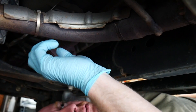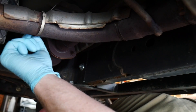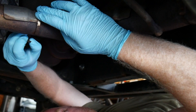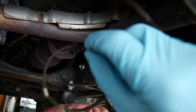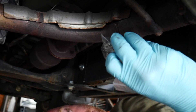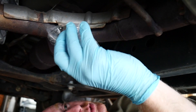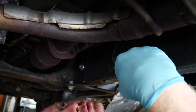So we're under the truck here, and this is the little clamp. As you can hear, it gets pretty crazy and loud. As you can see here, this one's broken. So what we're going to do is slide this one off, look at the diameter, take our new one, mark on the circle with a Sharpie pen as tight as we need to get it, put it down there, tighten it to where that one should have been, cut off any excess, start it up, take it for a test drive, and make sure we've gotten rid of the rattle.